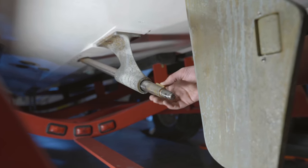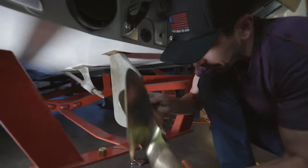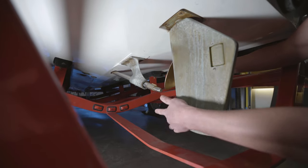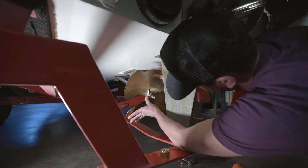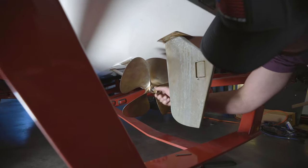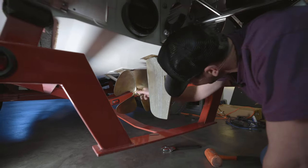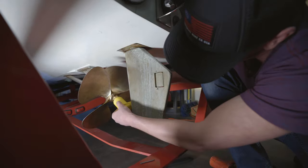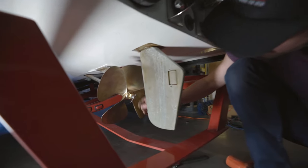Let's get this thing installed. Take your key, slide it in place, make sure it sits nice and flat. If there's any gunk in there, be sure to get that out. Take your propeller and slide it into place. Take your nut and get it on there. Once you get your nut tightened all the way on, take your cotter pin and slide it down into place.